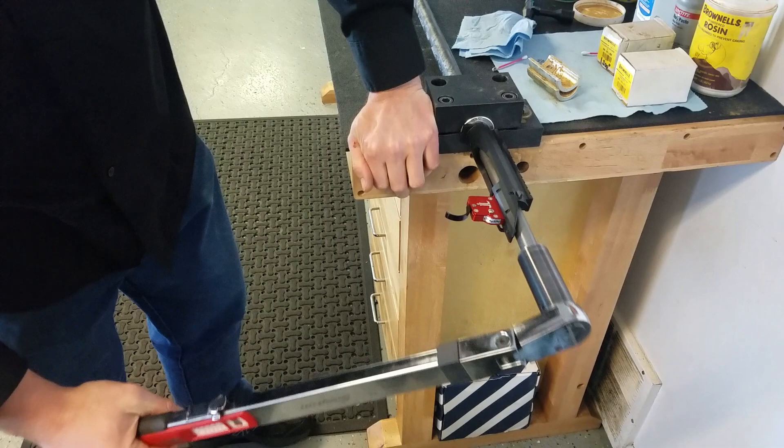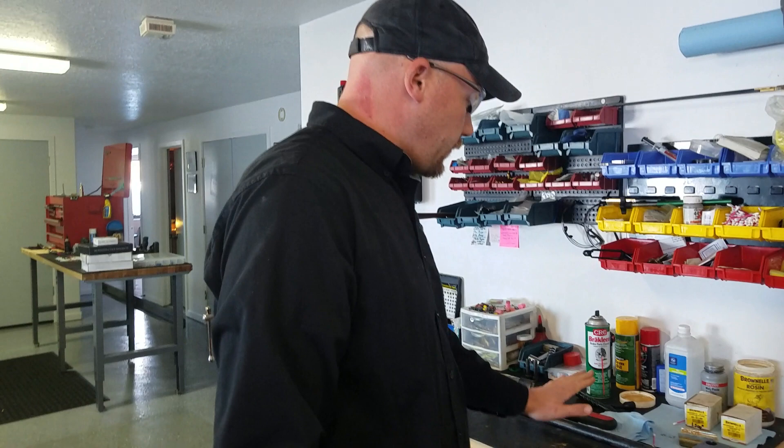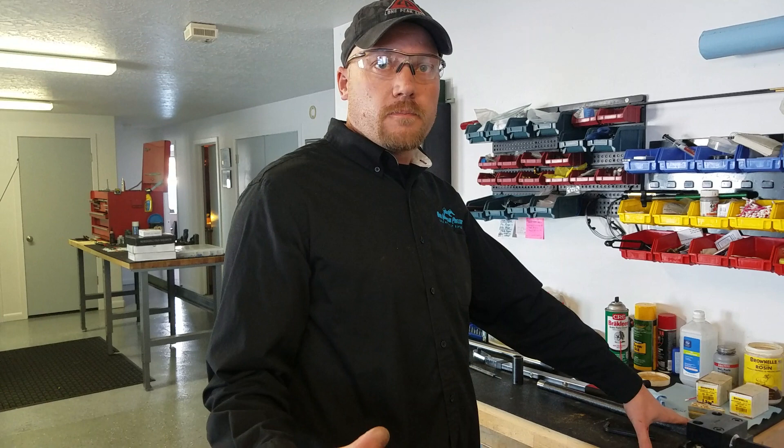That's it, guys — that's all you have to do. This rifle just went from a match range rifle in a 6-dasher to a 6.5 Creedmoor. All you've got to do is change out magazines and go have fun. This is Eric from Blue Mountain Precision showing you how to install one of our pre-fit, pre-head-spaced barrels on your Fusion Lone Peaks — or you can also do this on the Impact action as well, the 737R Impact action. Thanks, appreciate it. Shoot straight.